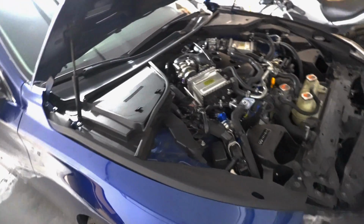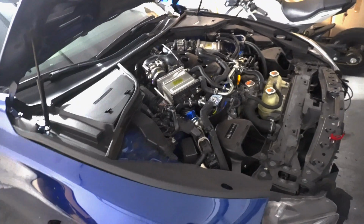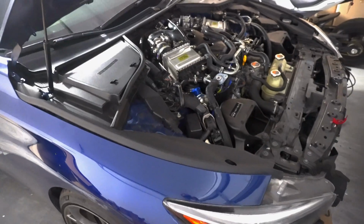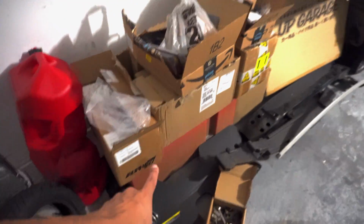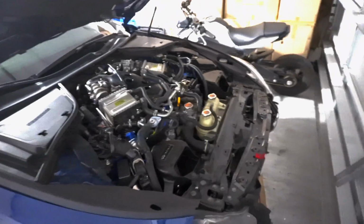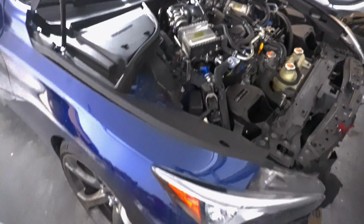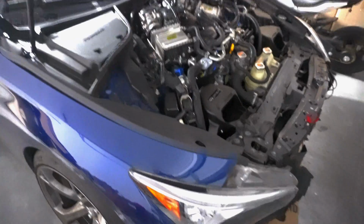Today's Saturday. I'm gonna work on the car again on Monday. Install a Flex Fuel kit along with the inline filter. Test the car and see if everything works perfectly fine. And then that's when I'm gonna park the car and pretty much open up the cooling system so I can install the AMS tanks, the inner chiller, and take the car then over to an AC place that's gonna tee into my suction line for the refrigerant, so I can actually charge up the car and see if the inner chiller actually works. Then after I do that is when I'm gonna install a high pressure fuel pump.